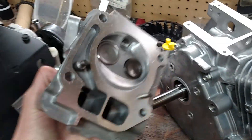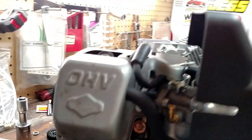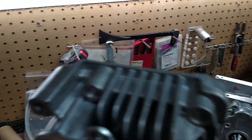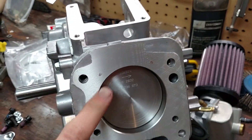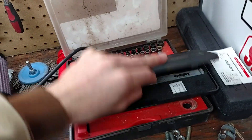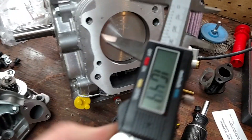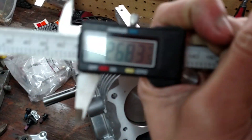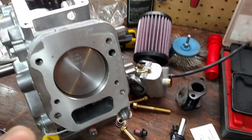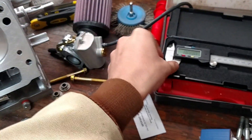The head — this is an Animal head — is actually identical to that of the Intech. I took it over and looked at it and the dimensions are even identical. This is the exact same width of a piston here. I had a digital caliper I was measuring it with: 2.68 inches. That's what the Animal racing engine is, and it was the exact same on the Intech engine. It was also 2.68 — something I was really looking into when I was trying to science all this out.